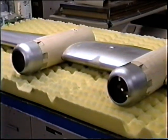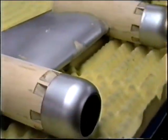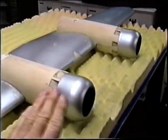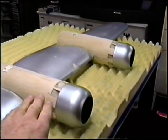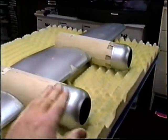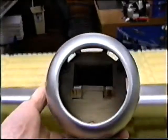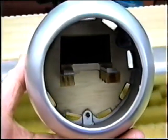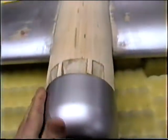But finally, after so many hours, the moment of truth has arrived. Both sides are done. I did some final fitting and sanding along the edges here, but we'll save the majority of it for when we actually get the silkspan on here to get the blend right to the thickness of a piece of paper. I think the air venting part of this is going to be exceptional. And it certainly will be a little more aerodynamic not having the cowl flaps open.